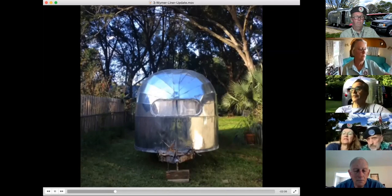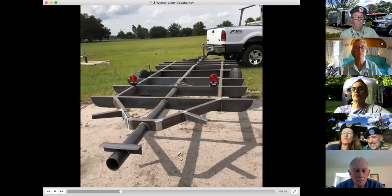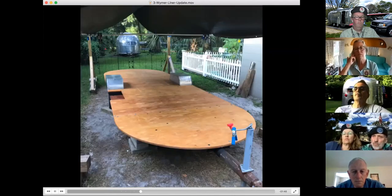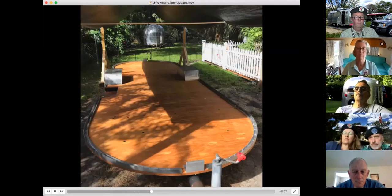We are currently about a quarter of the way through its complete restoration. One of the first things we did was have a local craftsman weld a ladder style frame for us. This new frame kept the iconic look of the pipe frame that the liners are known for. We painted the new frame with POR-15, modified the existing wheel wells, and installed a new subfloor using marine grade plywood. All new C-channel was fabricated and installed.